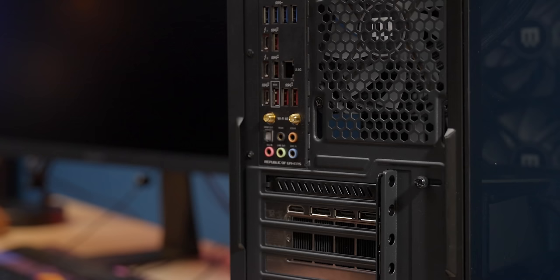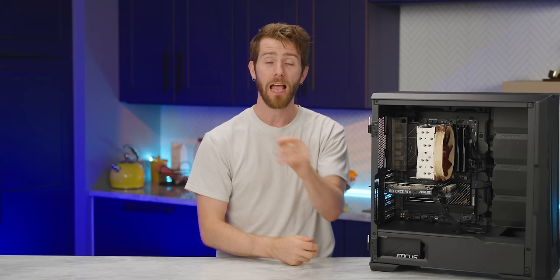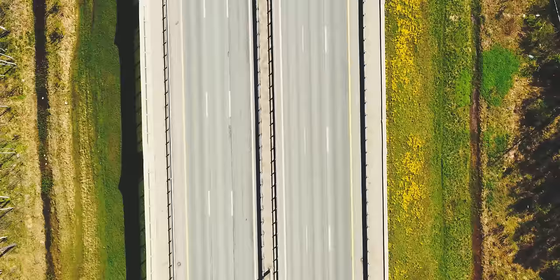Next up is display. Most gaming PCs come with a dedicated GPU installed in a PCI Express slot, and you should always plug your main display into that rather than the ports on your motherboard's IO panel — those are routed to your onboard graphics instead. With the right UEFI BIOS configuration, your system may support connecting extra monitors to both at the same time, but if you run your game off the wrong ports, it will have a negative impact on your gaming experience. As for which cable to use — HDMI, DisplayPort, or USB-C — that boils down to what your monitor and graphics card support. DisplayPort is usually the more correct choice for PC, thanks to its generally higher bandwidth and broader support for extras like variable refresh rate gaming.